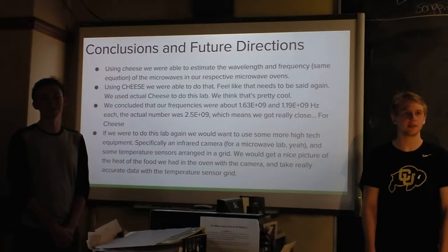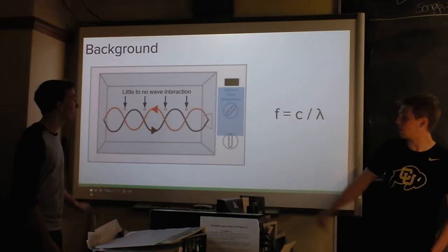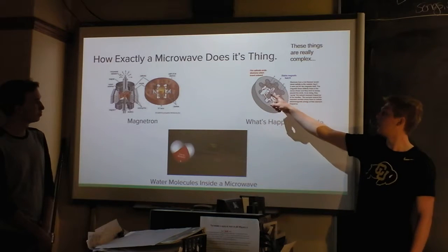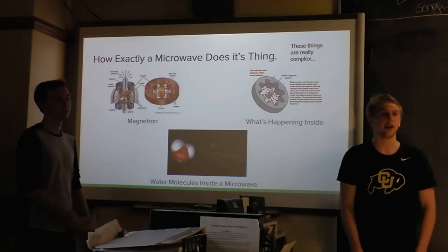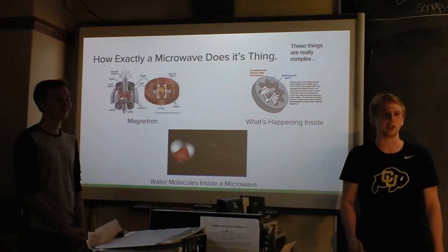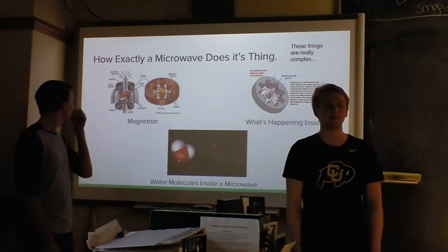Question from the audience: First, cheese is made from milk, correct? Yes. Second, you mentioned a vacuum tube inside the microwave — what is the purpose of the vacuum tube? Does every microwave have one? Yes, this is called a magnetron, and this is what produces the microwaves that get sent into the box. It does that by spinning an electric current around and exciting electrons that are in these holes, which then release energy as they fall back down to a less excited state. That process is similar to blowing over a bottle to make a noise. The magnetron is a kind of vacuum tube so that the electrons can spin around in a circle without running into nitrogen molecules.